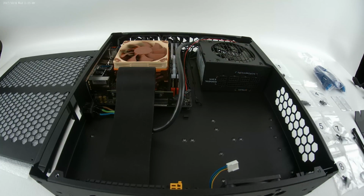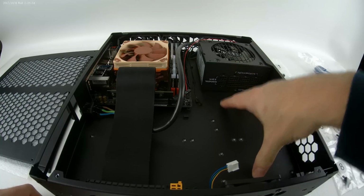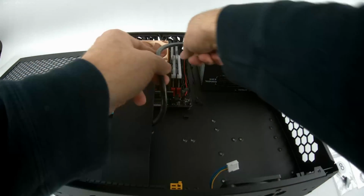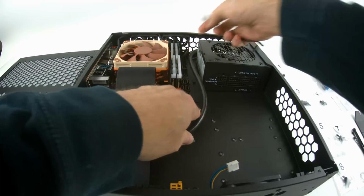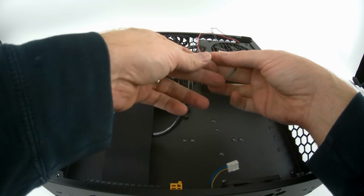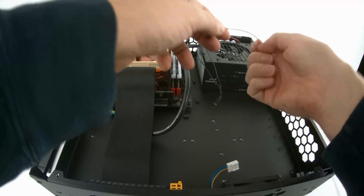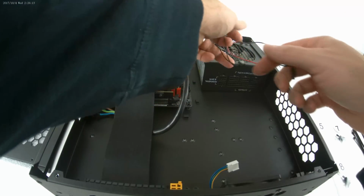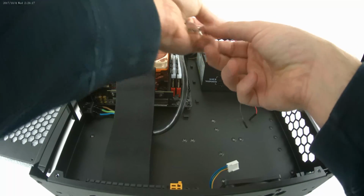The next step is going to be any of your hard drives or SSDs, which will mount in the bottom in these holes here. The back side has a label for where they go. Throughout, you might want to do some cable management. I know this is going to be a little bit messy. I understand that, because I don't have the time, while I'm making this video, to actually go ahead and clean everything up. But I'll try to get a picture of everything cleaned up, posted.